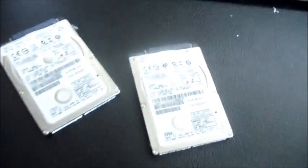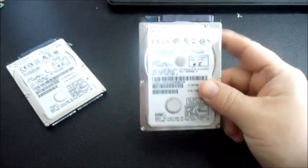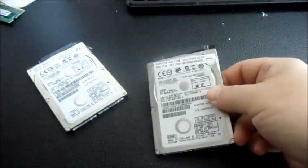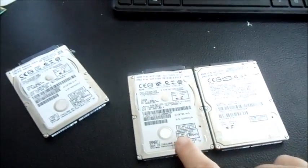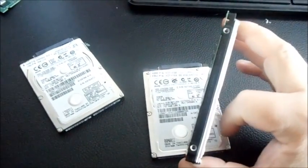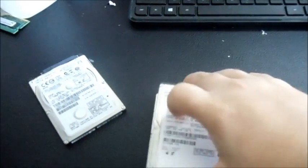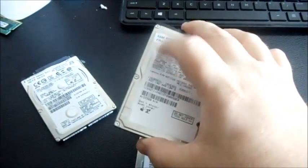With the Vivobooks, you have to have a thinner hard drive. They're still 2.5 inches, but if you'll notice, they're a lot thinner. This is what you would consider a regular size SATA hard drive. They're both SATA, but one's just thinner than the other. If you put them together, the one on the left is thin. If you try to install a regular thick SATA hard drive, it's not going to fit. Your lid's not going to close. I could put a link in the description where you can purchase them.